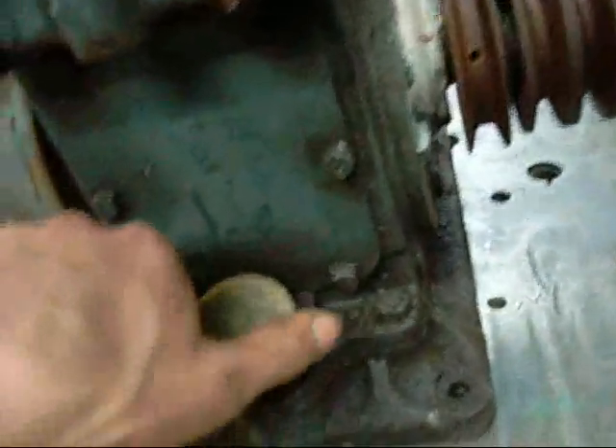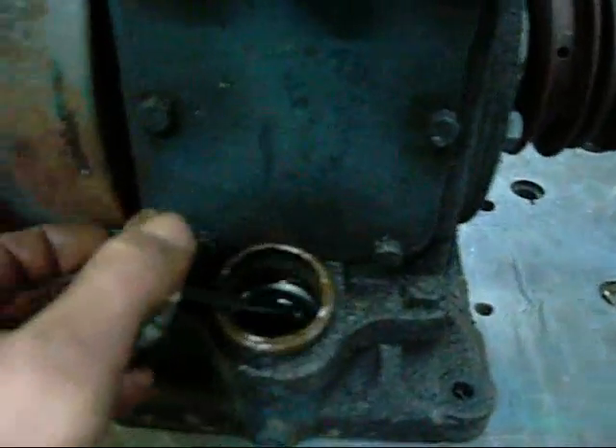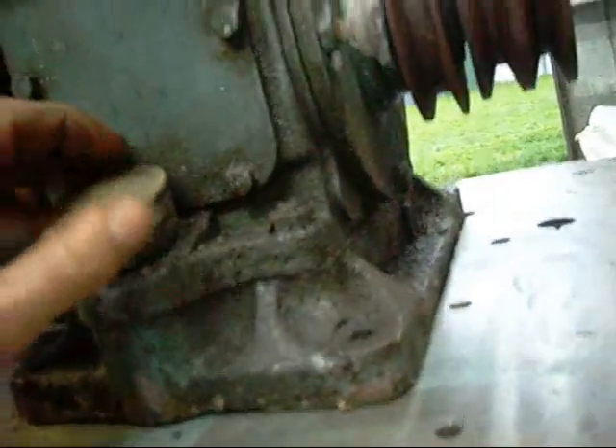I'm going to start troubleshooting it because there's no compression at the moment. I have a feeling one of the valves is stuck. The crankcase oil looked alright when I checked it. It's got a nice inspection cover there too, and that's all flywheel. There's no water in it, it's not excessively black — I think she'll be good. I'd say one of the exhaust valves got moisture around the stem, it's been left open and she's frozen.